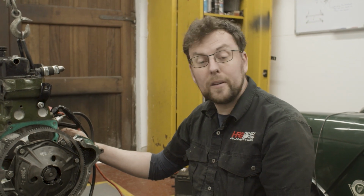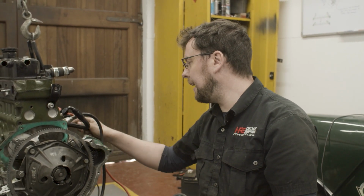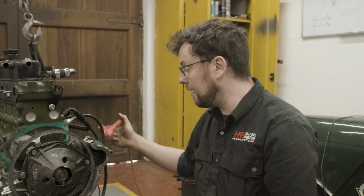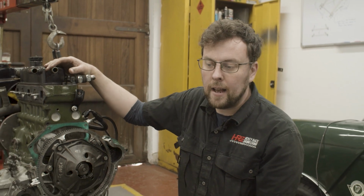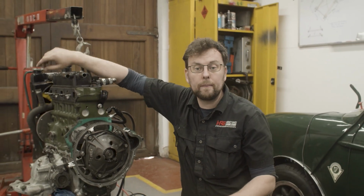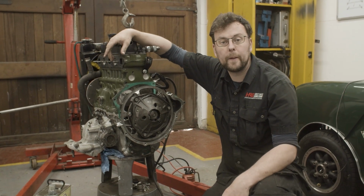So we've 60 pounds pressure on the starter motor. I think we have solved the problem. This is unfortunately an absolute clear case of a faulty oil pump, which is disappointing because you spend all the time and effort to build an engine really, really well, and you get let down by a part like this. I'm overcoming this now by making sure that every oil pump I fit from now on, I take apart and strip.